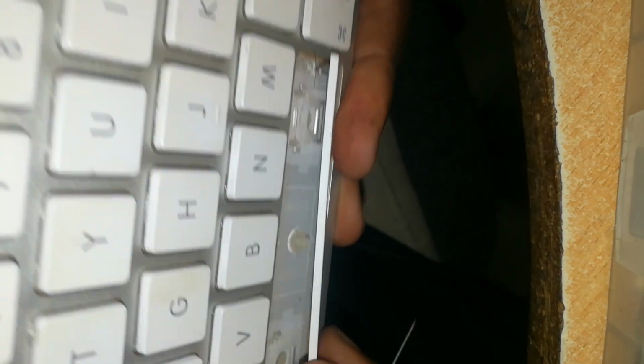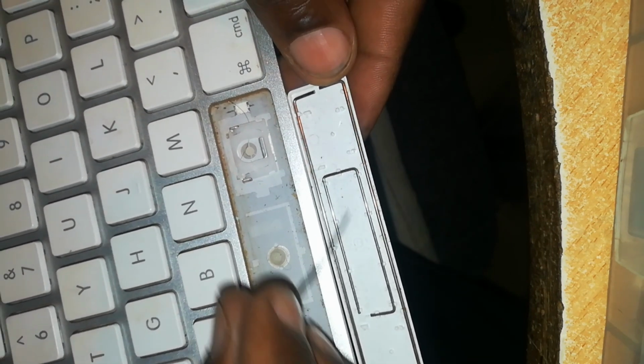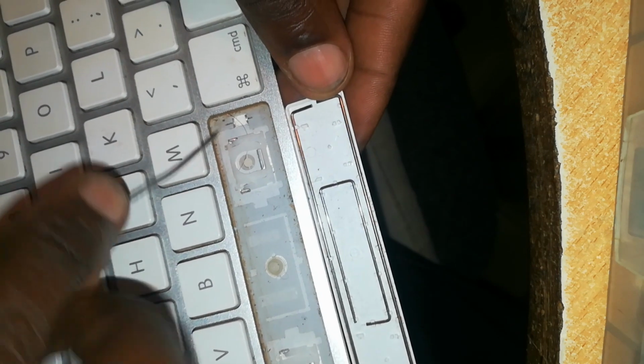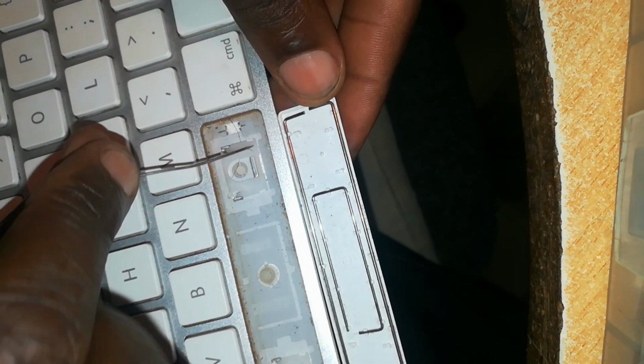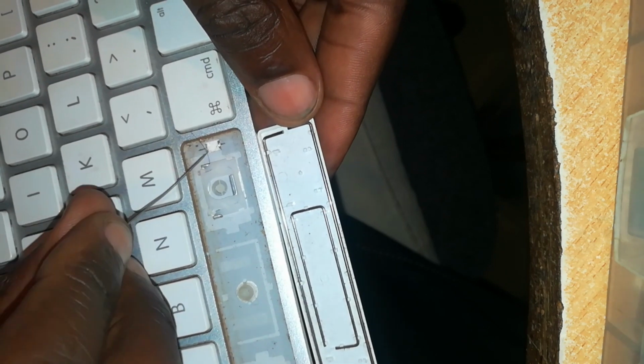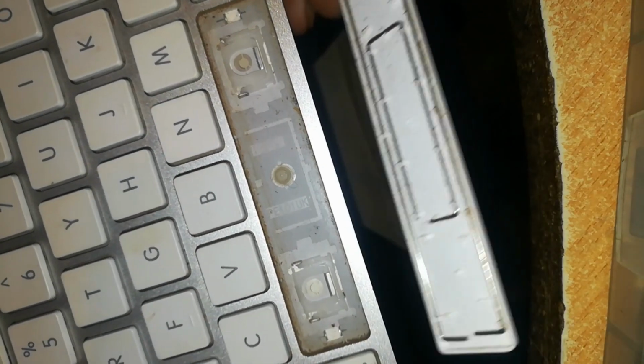So that's how it looks on the inside. Both are popped. And so just slide the key back and down. Lift the lower portion, slide it back for it to release from the board. There it is. And it has 3 wires inside. All these are to give it strength and to help it to attach and to lock. It's locking on 2 different portions, and so this will be a bit tricky to return, but I will tackle it. That's how you disconnect the spacebar.